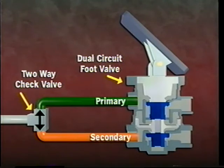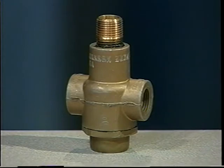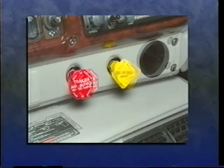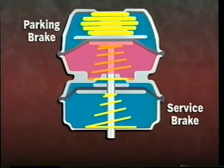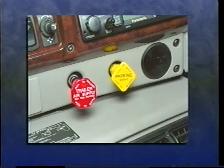The foot valve also delivers air to a two-way check valve that separates front and rear brake pressure and allows the dominant pressure to operate the stoplight switch. The park and emergency brake system starts with a two-way check valve that directs the higher pressure of the primary or secondary tank to the parking or emergency brake. The parking brakes are controlled by dash-mounted push-pull valves: the red octagon knob is for the trailer supply brakes, and the yellow diamond knob controls the tractor park brakes. When the knob is pushed in, air travels to the spring brake and the spring force is overcome, releasing the brakes. Control and supply air to the trailer passes through the tractor protection valve; in the event of significant pressure loss, the red dash-mounted knob will pop out to close off the supply line and protect air in the tractor.